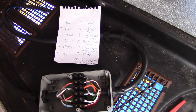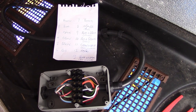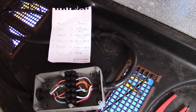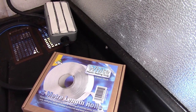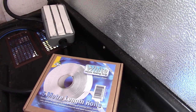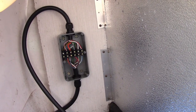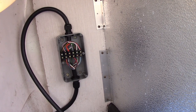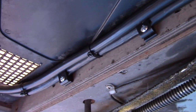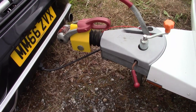That's all cables connected into the connector block with the corresponding colours. I just need to screw up the grommets on the end of the box and fit it to the sidewall. On the back of the box I've put three strips of mastic sealing strip — it's not hard up against the wall so it'll be screwed in well but give it a bit more protection too. That's all in place, screwed in. Just the front cover to put on and underneath we're all cable clipped and cable tied. That's where it goes into the locker box and the other side is clipped onto the chassis.